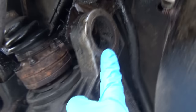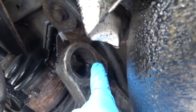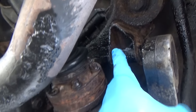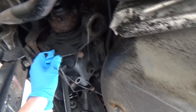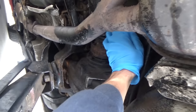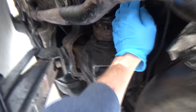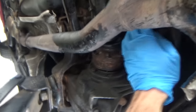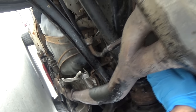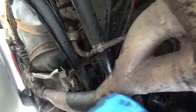There's a tree. The reason why it sounded like that is because the differential actually came out of place. If you look here, you can see that there's something missing. There's a rubber mount that goes inside there and then bolts into this. What's happening is the drive shaft is spinning and when it turns, it does this. The noise we were hearing was both the drive shaft rubbing and then the differential bottoming out like that. As you can see, it moves the CV axle as well and that's rubbing. See the wear marks? Real fun.